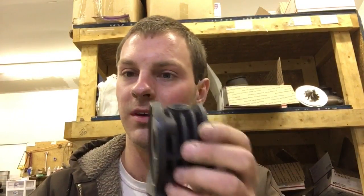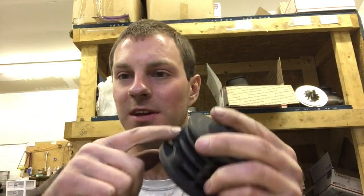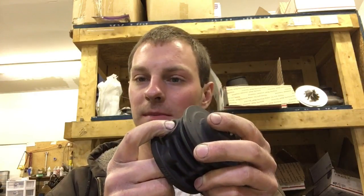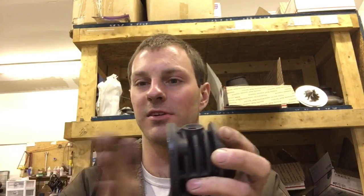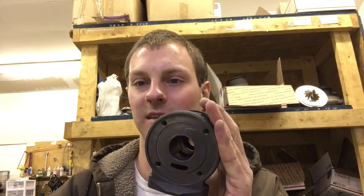This one's the Gen 2. The most common mistake I see with this is that the oil feed restrictor pin is removed and somebody is trying to use the turbo without it. This piece holds the cage in place, and if you don't have that, the cage will start to slide. That's the most common thing I see — people make a mistake or tamper with that and mess it up.